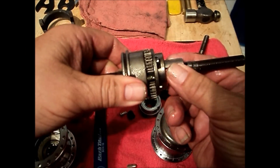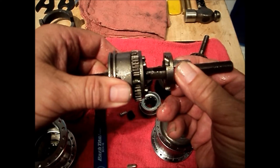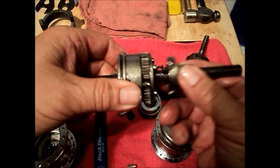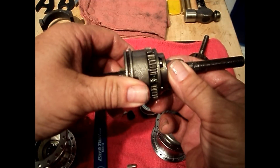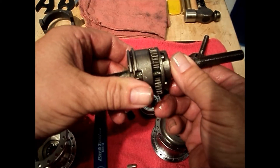So the two functions of the clutch are: in the fully retracted position, to retract the pawls; and in the fully advanced position, to transmit the power to the planet carrier.